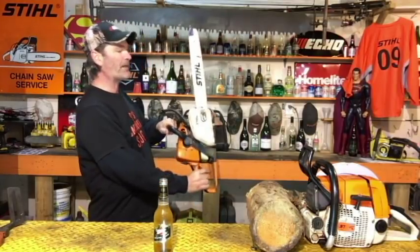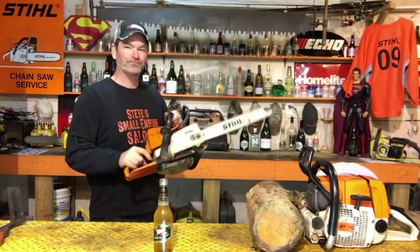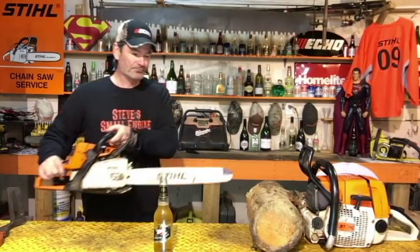It's going to flip up right into your face. That's what a kickback is. And that's why we need to test your chain brake, you guys, so that doesn't happen to you. I have personally met 3 men in my life that have had a kickback where it hit them in the face with a moving chain because their chain brake did not work properly.